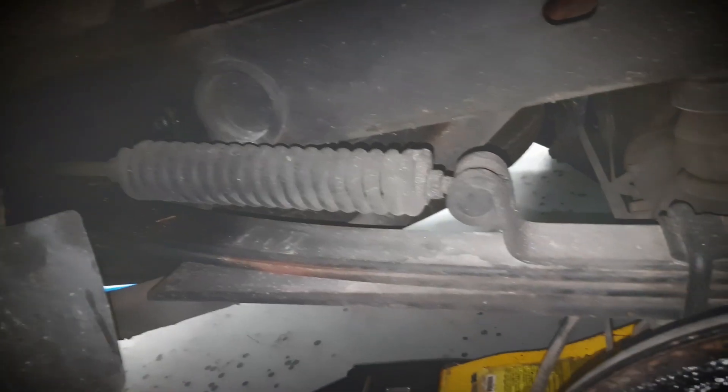If you have airbags, that's great, but if you have airbags with pressure in them the truck's just super jittery on the road. If you have an added leaf it's really harsh, and if you have a helper spring it's the same thing. So a lot of these modifications to aid the rear suspension didn't help me, because I would actually lose control with an unloaded truck.